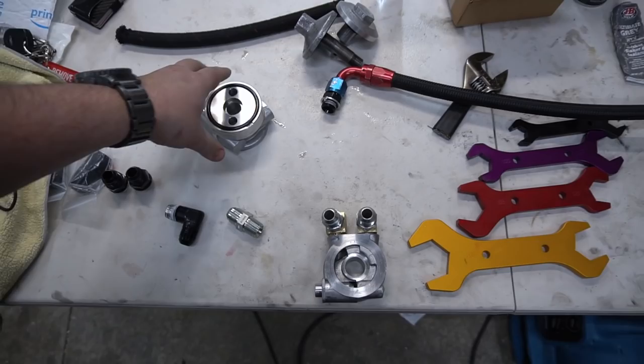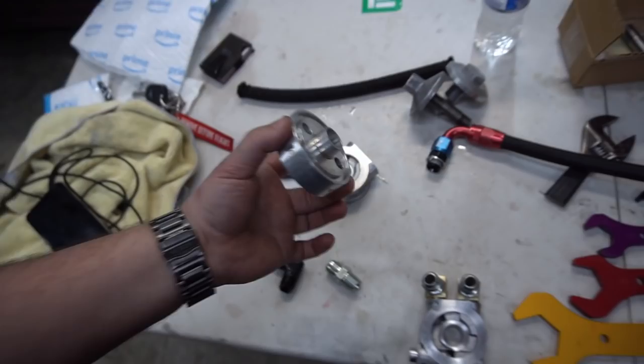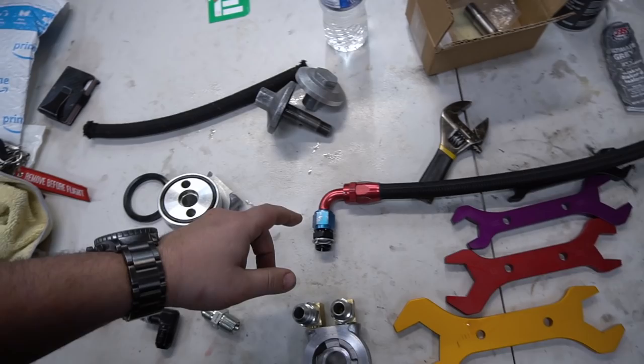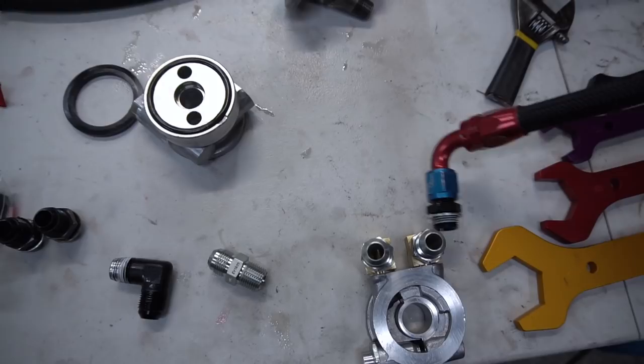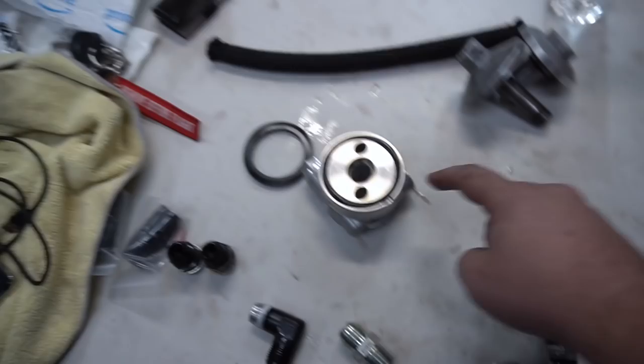However, we realized why it was needed, because of the old owner. We know why it's needed. It's because there's a coolant pipe that travels over, let me see, is it on the stock? So many motors here. So here's the water pump, and then there's a pipe that goes all the way out here. And that oil cooler right above it, there's no clearance. So this is the line that would normally be on there. And you see how high that is? It would literally hit against there if you weren't using the spacer. But he used the spacer to bring it out so you wouldn't have to worry about clearance.